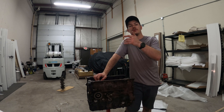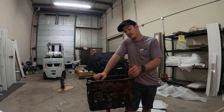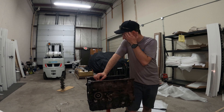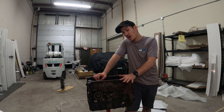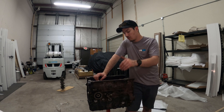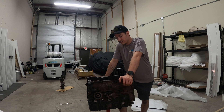I've got the main bearings - standard Glyco, they're an OEM bearing. I've got new main bearing bolts because they're stretch bolts. I decided not to go with ARP on those for now because plenty of people have been making quite a bit of power on just the stock bolts and they're considerably cheaper. Going to throw in this side of the bearings, spray down the crankshaft with air to make sure there's no particles on there, set it down, and tighten up the main caps. I'm going to bring it down to the factory torque - I want to say it's like 30 newton meters - before the half turn to final spec. I'll bring it to 30 newton meters and see what happens.